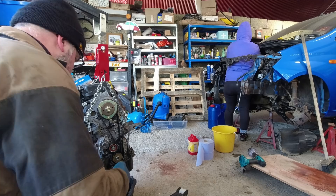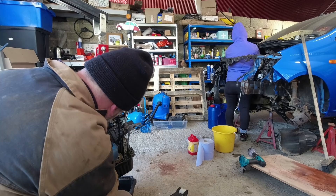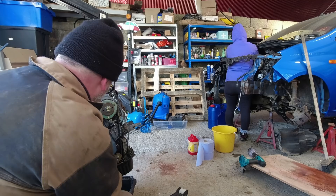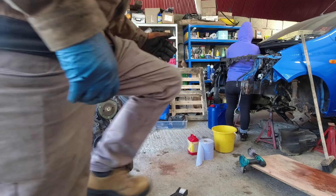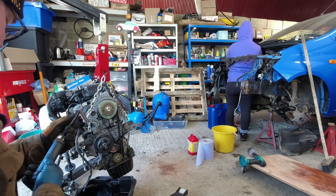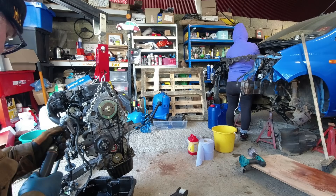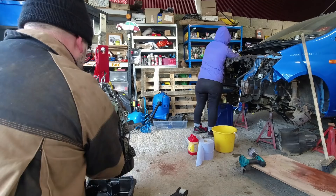I'm going to put the pulley on — it came off this engine so it's here. More little 10-mils to hold that on. The cleaning has been held up because the drill battery seems to have failed. Would be lovely to have a little brush — there's bits of flora in here, which means it's basically carbon neutral. These little bolts should be torqued up — crazy, actually using a torque wrench. The manual says 9.5 Newton metres. I was looking at the wrong scale and may have slightly over-torqued that one.